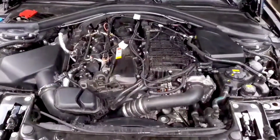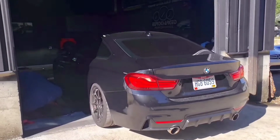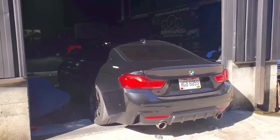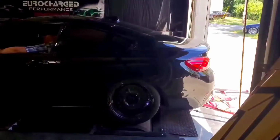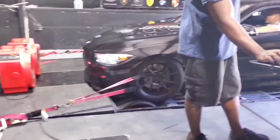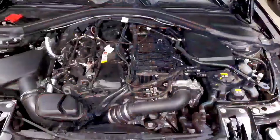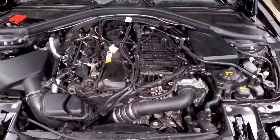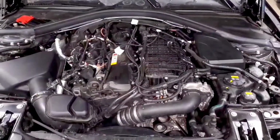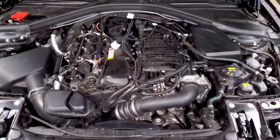Now, like I said, this is the same way that you're doing a dyno pull. So even if you don't want to do pulls on the highway and potentially get a ticket from getting up to high speeds, you can go to a dyno, get a dyno tune, log it while it's on the dyno using the same strategy, and you'll get the same data to your tuner, and they can make the tune that way. So it just kind of depends on your needs and how comfortable you are with it. Usually it's better to log it on the street just because it's a better environment and replication of what you're actually experiencing when you drive the car. But a properly loaded and calibrated dyno can help you get a very good tune as well.